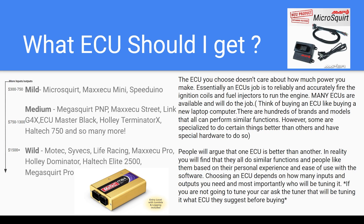Typically there are very inexpensive ECUs at the bottom end. We start with something like Speeduino — it's somewhat of an open source project where you basically buy the boards and solder them together, kind of like how old Megasquirt products were made. It's more of a DIY approach, definitely not for everyone. They're coming out with more SMD units that are pre-soldered and more compact, which are really good, but you're going to put in a lot more DIY time configuring and setting it up versus a more established product.